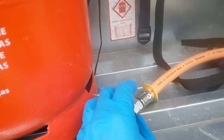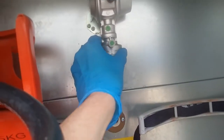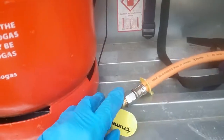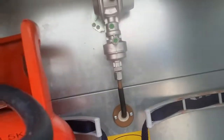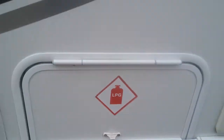This stops gas escaping from the bottle if there is any damage inside the motorhome. The crash valve in this part of the regulator also recognises a sudden drop in gas pressure and will stop gas leaking inside. Sometimes these can be triggered if you go over a bump quite violently, so if you're still not getting gas, press and hold the reset button here for three or four seconds to reset the crash valve. The beauty of this system is that you do not need to turn your gas bottle off for travel.